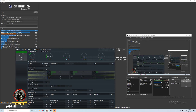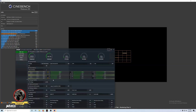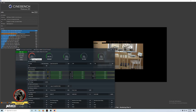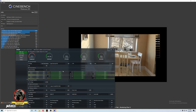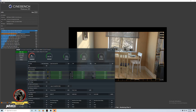I'm just going to run this and see what it does. You can see all the processors firing at 38. The temps are hitting 95 degrees with all cores loaded — I feel like that's just too high. It's pegged out at 95 degrees, and basically it throttled. It hit 95 and they all throttled at 39.57. I don't feel like overall performance is the issue — it's the temperature that I'm worried about.